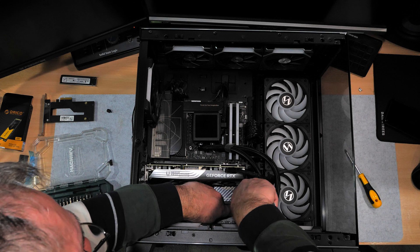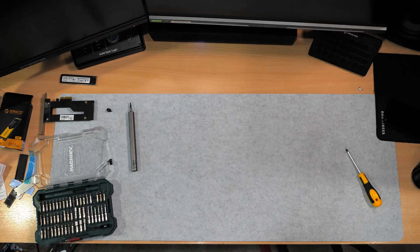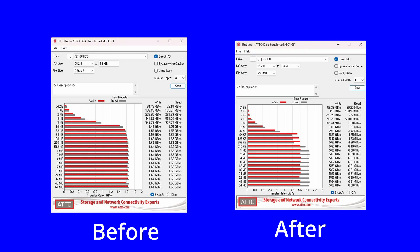I had other things plugged into my PCIe slots which were reducing bandwidth. So I put the drive straight to the motherboard, and sure enough that was the fix. The results were spot on — they said up to 7,000 megabytes per second and they were right. I apologize for doubting them. It wasn't the dock per se — it was the PCIe slot not performing at full bandwidth because other devices were plugged in. We got there in the end. I can recommend the Orico, especially the 2 terabyte.